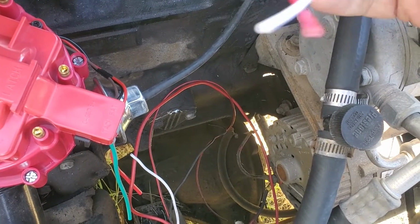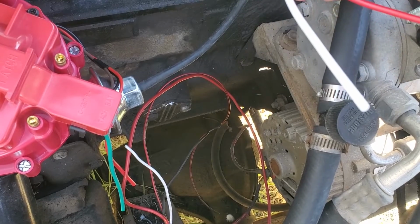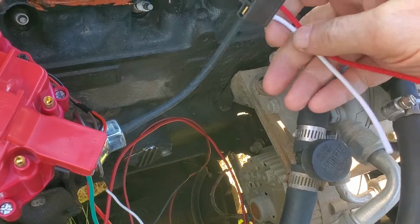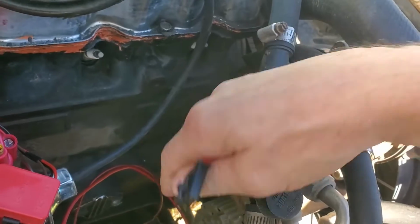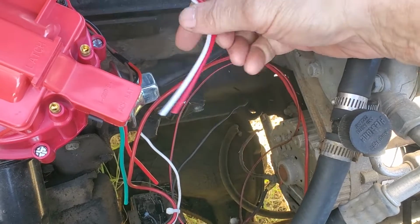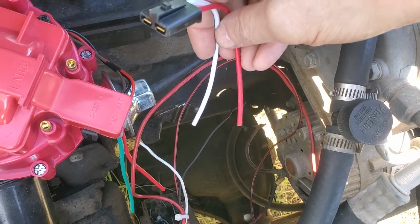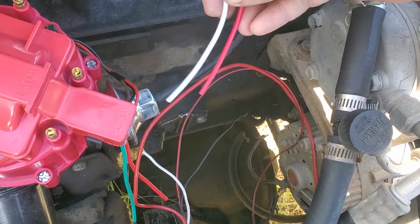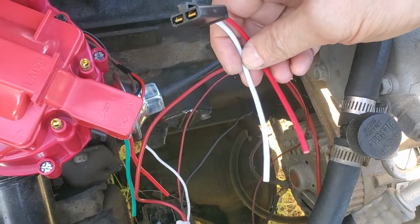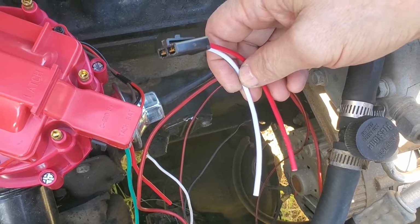And the white wire is what's called the excite wire. It gets 12 volts into it. And a lot of guys I'm seeing are just taking this heavy 12 gauge wire from the other side for the ignition and putting that in there on this. Now that works fine and it'll run the engine. The problem is, if you have one of these pigtails that does not have a diode on that white wire, you will not be able to turn your engine off if you have a carburetor.